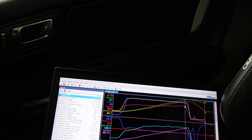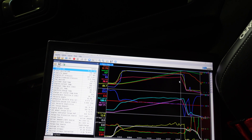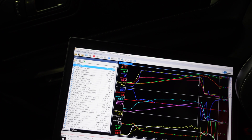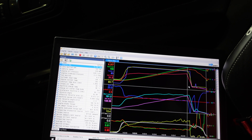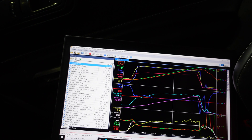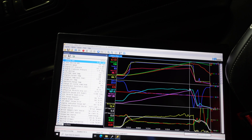If we did a bigger throttle body — like my car has — I'm seeing about 15 pounds. The only thing with the bigger throttle bodies is there's a funky tip-in issue during road racing situations. If you're at 6000 RPM and you're kind of holding the throttle on and off through a sweeping corner at high speed, the throttle body wants to shuttle around a little bit. Idle and drivability on the street are fine — it's just that high-RPM open-close cycling. Something I'm still working through before selling it to road race customers.